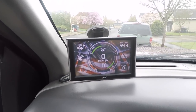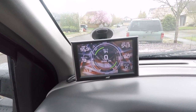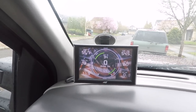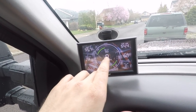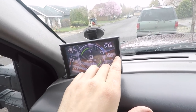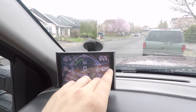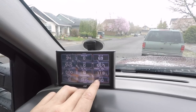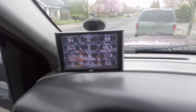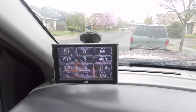As you can see, it monitors live. I've got battery voltage down there — it's a little low right now because I keep having the truck on without actually running it trying to film this video. But we've got oil temperature, outside temperature, transmission temperature, fuel pressure — all of these different things that you can monitor. Two very important ones are your IPR regulator and your ICP pressure, which for 7.3s are kind of the heart of the engine — you're not going anywhere if those aren't working right. In general, this thing can monitor way more than I even need.